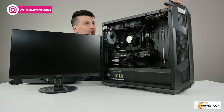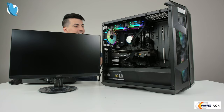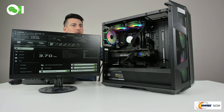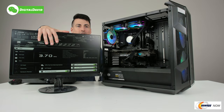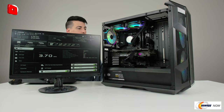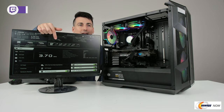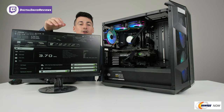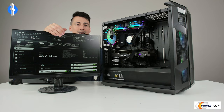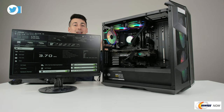All right, it's time for the big reveal. Here we go, let's push the power button — check that out! We have power, the fans are spinning, that's definitely a good sign. Let's see if we're able to get into our BIOS settings as well. And there we go, the BIOS is loaded up on the screen and everything is working properly. Super excited for this. So now at this stage I highly recommend going in your BIOS settings and configuring your RAM to make sure you're getting the correct speed — overclock it per the user guide manual for your RAM as well as your motherboard settings. You can just change your XMP profile. Now we're ready to go ahead and power everything down and cable manage.